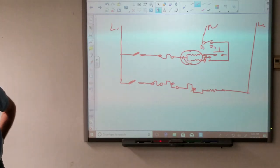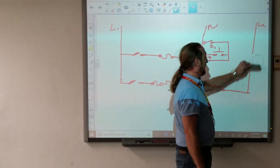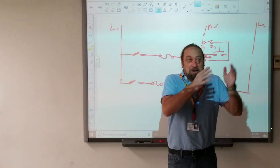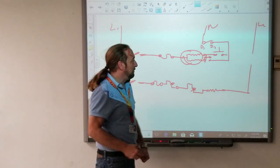If they can tell me which two terminals? Two. One and two. Very good. Now, if one of you could answer, it's in the motor — the motor centrifugal switch, one M to two M. Almost all dryers, it's the same one.